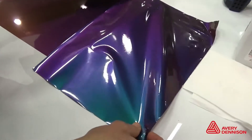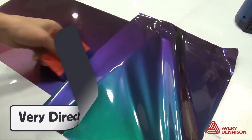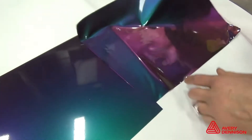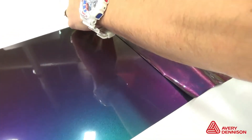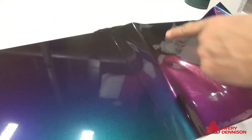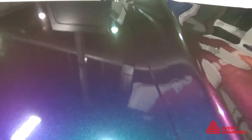It is very important to note that SW900 Color Flow Gloss is very directional. Three out of the four sides of a square piece won't match up. Lining the panels up precisely is critical for perfect balance of color and hue.